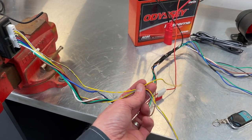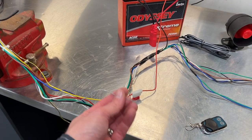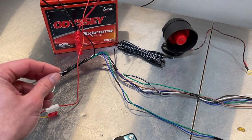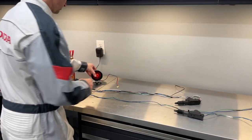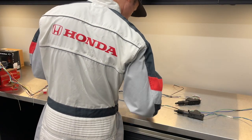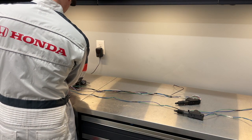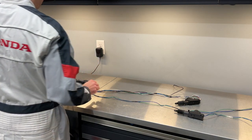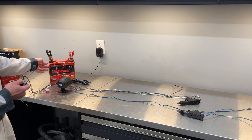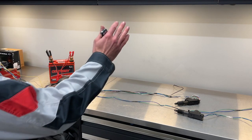These two yellow wires are actually for your blinkers, so you can hook those up so that when you hit the unlock button they'll blink for a visual confirmation that you've locked or unlocked your truck. The gray wire is the output for the horn. I'm going to loosely connect the horn just to test it with battery power. At this point we know our whole setup works — we've got the horn and we've got the actuators.